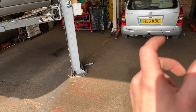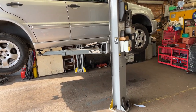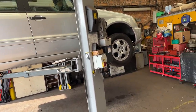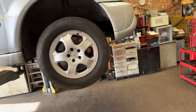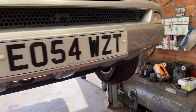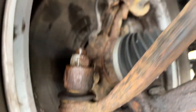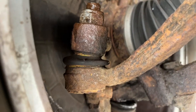You can't just go off vehicles' VIN plates because that's your maximum authorised mass. A four-ton unladen weight would be one hell of a vehicle — even a big ambulance wouldn't be four ton empty. Anyway, we'll get the wheel off. I'll show you why we're changing it: work the play on the wheel — see that popping up and down? That is why we're changing it. There's a lot of play in that ball joint.